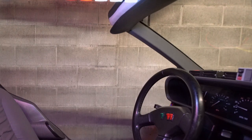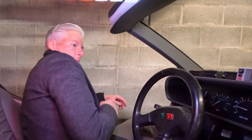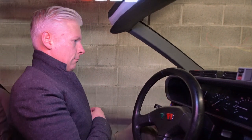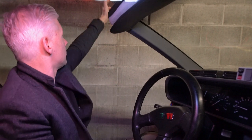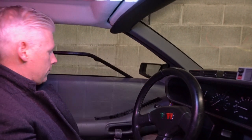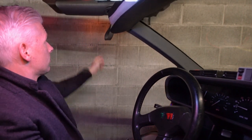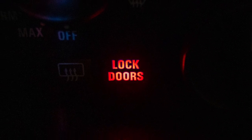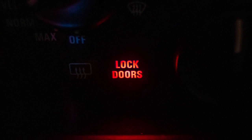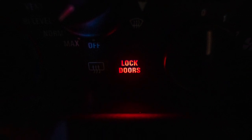There is a recommended way to close the doors from both the outside and the inside. This method is recommended to help reduce wear and tear on the door. Pull downward, switch to your other hand, pull down and in, then put your other arm on the armrest of the door and bring your arm down. To release, use two fingers, pull up on the little tab — kind of like you're opening a pop can — and the door should take it from there. There is also a locked doors indicator that illuminates when you have the doors closed but not locked. The DeLorean manual says you should be driving with the doors locked, for reduced chance of the doors opening during driving and for mechanical stability.